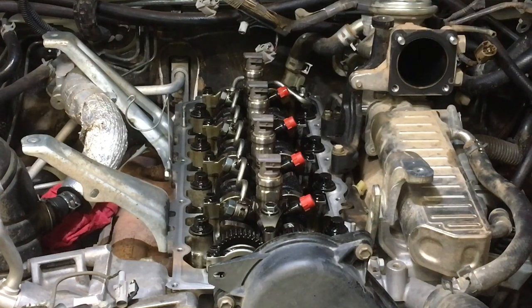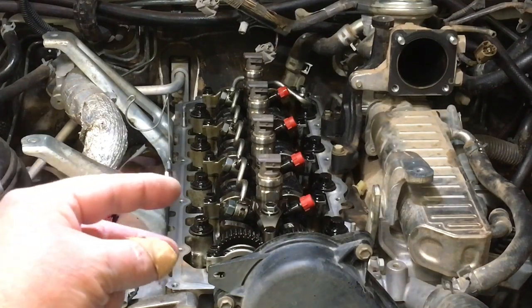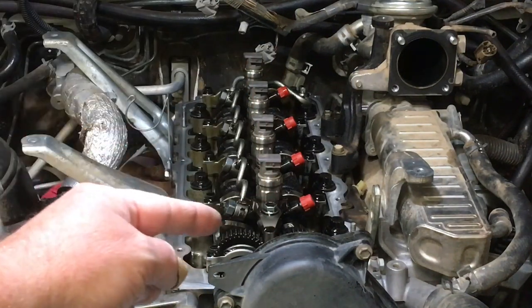Whenever people are having injectors replaced at lower kilometers, like say someone bought a 2012, 13, 14 or 15 1KD Prado brand new, and then at around 50 or 60 or 80 or 90,000 Ks it was a bit noisy, it's got a bit of a knock or whatever. Every time we've followed it up with our investigations, we can trace it back to a service at a Toyota dealer at 40 or 80,000, where to do the job correctly, you're meant to remove these injectors to check the valve clearances every 40.